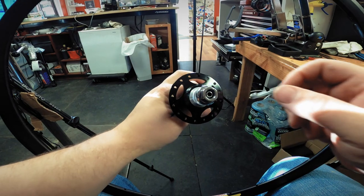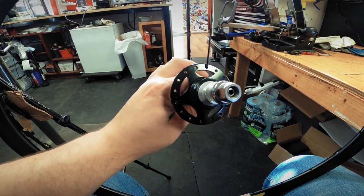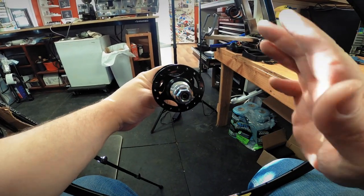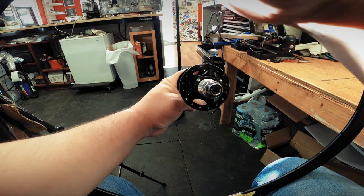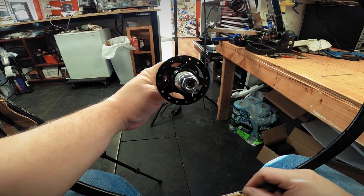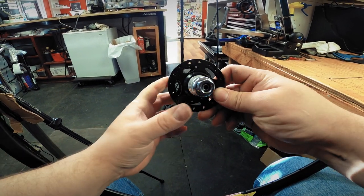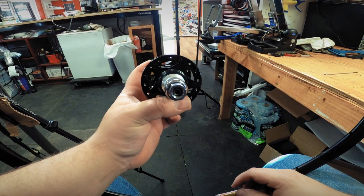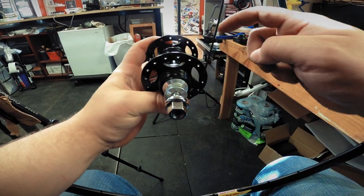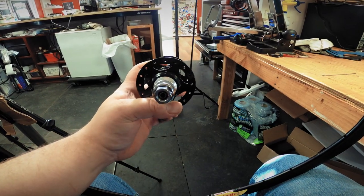When dropping the spokes through the hub flange, there's a lot of debate on heads-in versus heads-out for the trailing spoke. This first spoke is going to be the trailing because the hub is going to turn in this direction, so it's going to be angled away from the direction the wheel is rolling. It doesn't matter — I've talked to people with really fancy equipment that's tested it and it doesn't actually make a difference, but people like to have very strong opinions on that anyway. So we're starting off about 90 degrees from the logo on the hub, two holes from the valve hole.